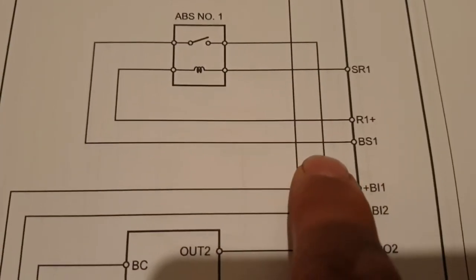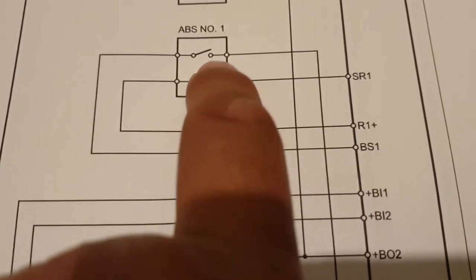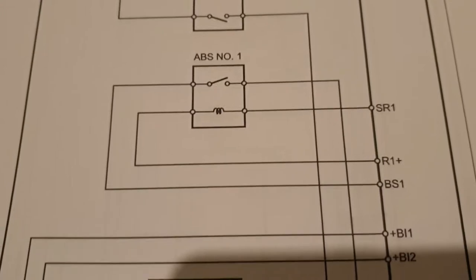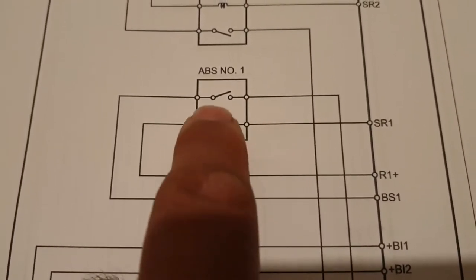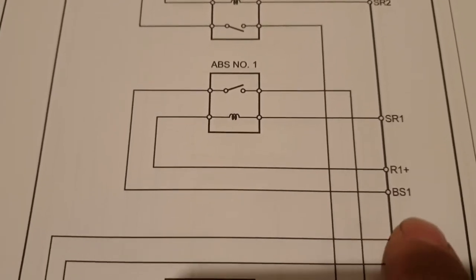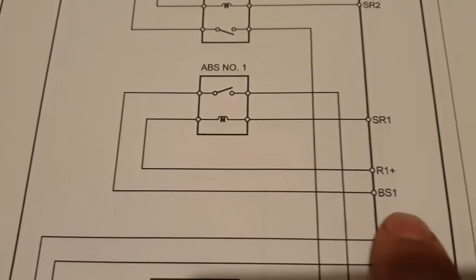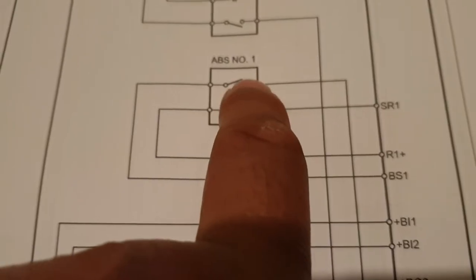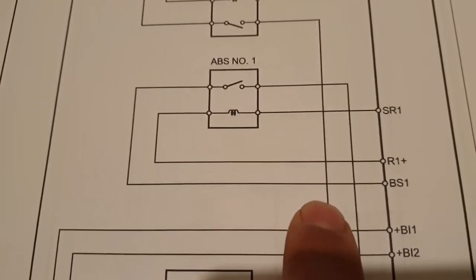So it means that when this circuit is delayed, closing these two contacts, two points at this contact, for at least 0.2 seconds, the fault code is going to be stored while the voltage applied to the control circuit of the relay is 9.5 volt or more. This is one condition. Second condition is this. When the voltage applied here is less than 9.5 volt, and the load circuit voltage is sensed by the ECU at more than 3.5 volt for at least 0.2 second, the fault code is going to be stored too.